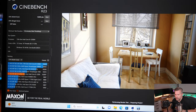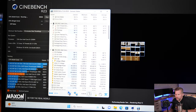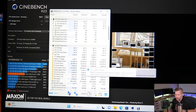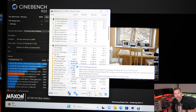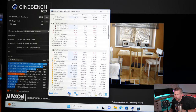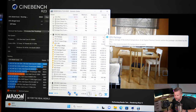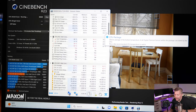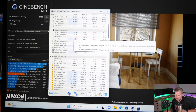So, all right, let's go ahead and start. Our second run got 14,293, though I was messing with HW info. So here's our 10-minute run start. I'm noticing that our temps are getting pretty dang high. Wow, we're pulling 91 watts. Holy moly. That's pretty insane. Our temperatures are going up there too. But it's nice to see the Gigabyte letting this sucker fly. Like it's flying really high. Now, these temperatures are pretty high. Keep in mind, they are within the Intel rated spec temperatures.